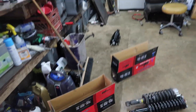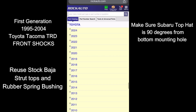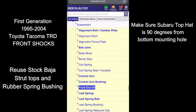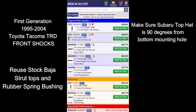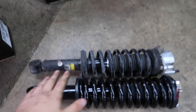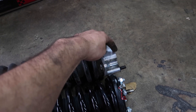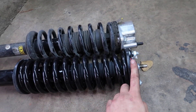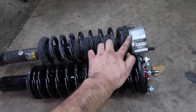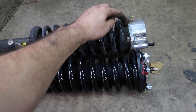If you see here, these are Toyota Tacoma four-wheel drive pre-runner shocks. I went on Rock Auto and got 1998 Toyota Tacoma front four-wheel drive pre-runner shocks — the cheapest ones I could get — and they ended up working just fine. Here are the prices as of December 2023. This is the OEM Subaru rear with a three inch strut top spacer — it's actually two inches but it's supposed to raise it three inches. This is the four-wheel drive one, and you can see it is barely taller, but this should be a lot stiffer because this one sagged down a lot.